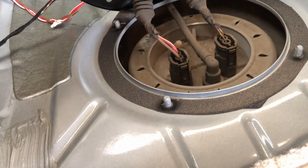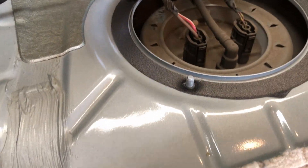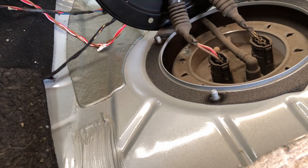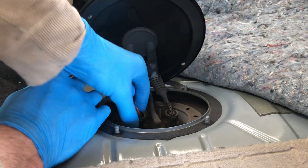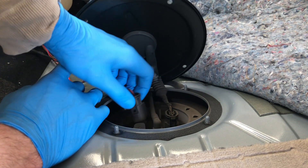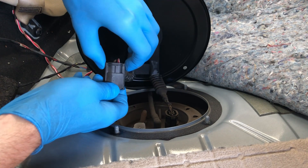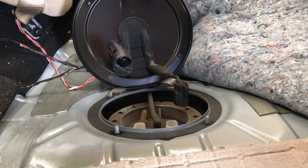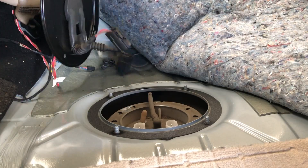There we go, there's a fuel pump in there somewhere. It's pretty dirty down there - might be time to put my gloves on. To get these plugs out you just push those two tabs in at the side. They came off super easily, so that was good, and that's off so now we can get that out of the way.